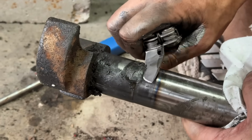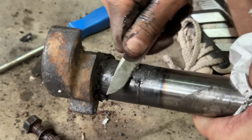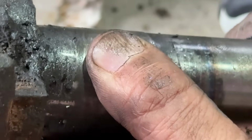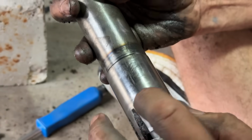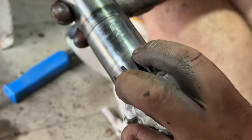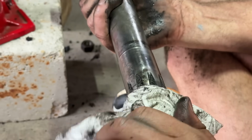It's like the bushing all burned up or something. No, I don't think so. Something plastic. But the metal's fine. See where the bushing rides here. I mean, that looks excellent. This all looks fine. It just gets a little funky out here on the end where it was sitting in the edge of that tube there. But that's not where the bearing rides, so it doesn't matter. The bearing rides right here. So the S-cam itself is actually in great condition. The bushings are just gone.